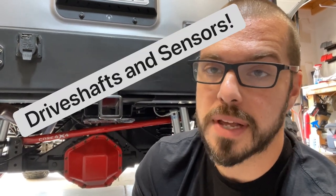Here we are at the end of this video: drive shafts, wheel speed sensors, ABS. For drive shafts I went with a 1350 from Adams — I measured the length, got it made. It's a 1350 U-joint style solid — not greasable, the inside is hollow — and I feel like the solid 1350 extreme duty shafts are just much stronger. I've never had an issue.